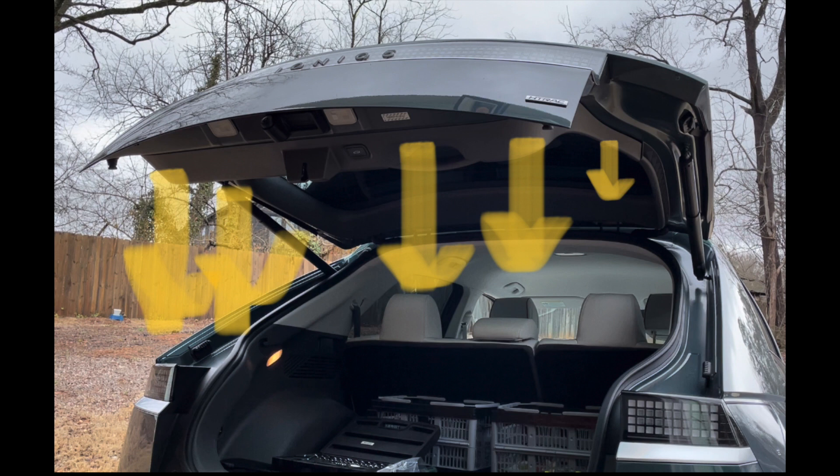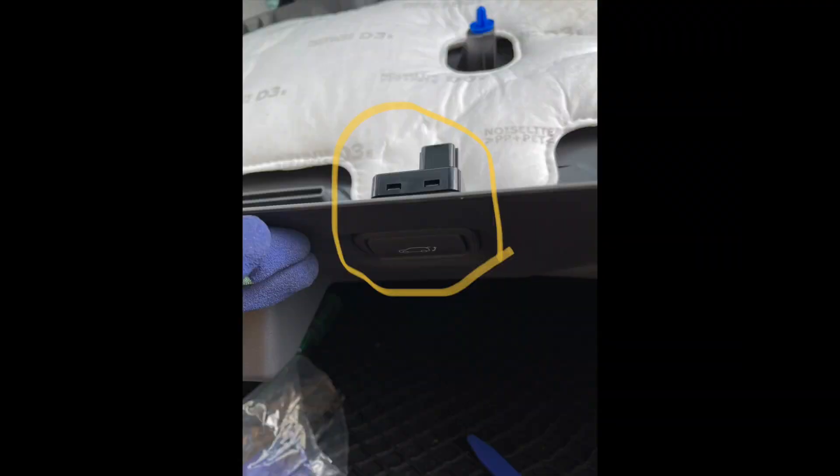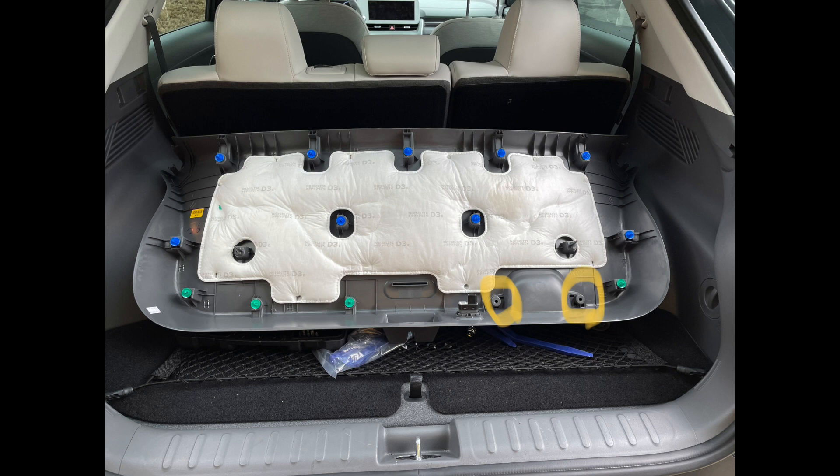Be careful not to pull down too much, as you don't want to harm the tailgate inner switch connector. From the picture, remove the tailgate inner switch. After removing the lower tailgate trim, check all clips so they can be reused. If you have any broken clips, you may need to replace them with new ones. Note the yellow circles indicate handle bolt locations, not clip spots.